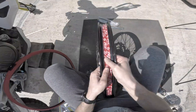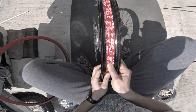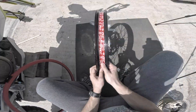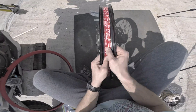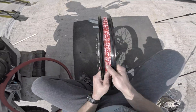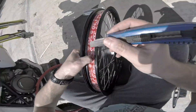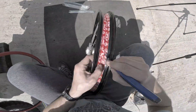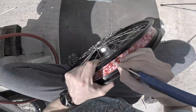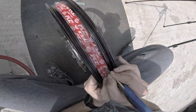After finishing this, apply some pressure along the entire rim so that everything will stick properly. Everything will stick together when you inflate the high pressure tube anyway, but it's better to be safe. Now using a sharp cutter, cut the tape where it's covering the two valve holes. You can first pinch the tape and after that cut along the hole to have a nice round hole in the tape.